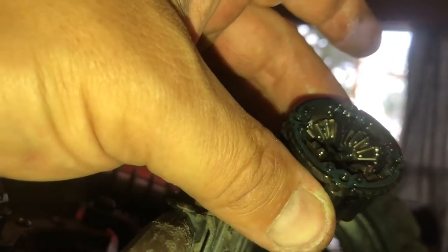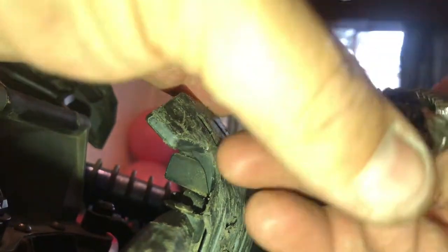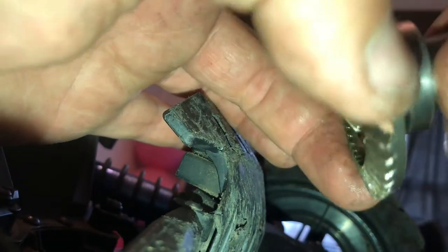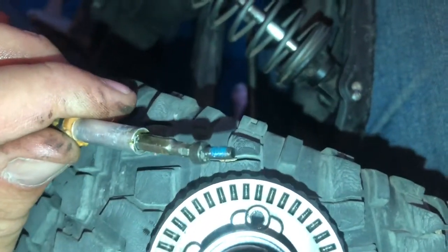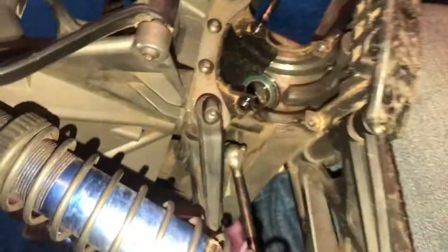That's the internals of the diff — you don't want to touch that, just leave it on the side. And that's your gear. Now you still cannot just replace the gear; you still have to remove that hub with the pinion inside, and the bearing. It's stuck in here. The bolt is out. It was so dirty in there I couldn't see how small or big the screw was, but it's exactly the same size as all the other screws you've undone so far — so you use exactly the same size hex key.